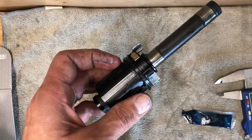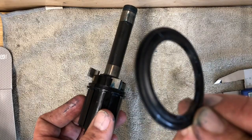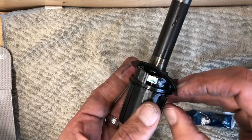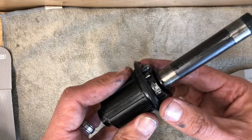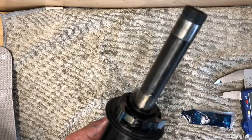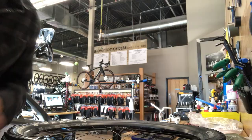Time to put the little top-hat rubber seal on there. The schematic showed putting it on with the flat surface in, but that didn't seem like it really lined up right. This is the orientation the other one was on — it kind of just fits into the hub. There are kind of stair-steps in the hub shell there, so this little rubber seal matched up better. It seems like there's a little logo on the outside edge of it as well. That's how I ran it. Really at that point it's pretty simple — there are several other hubs, axles, and freehub bodies that are very similar to this.